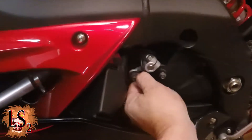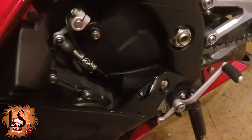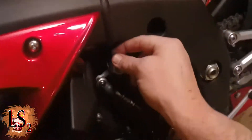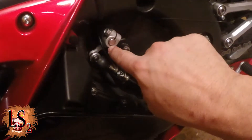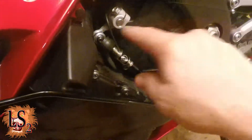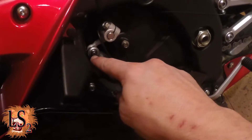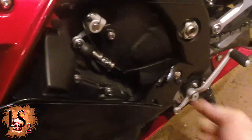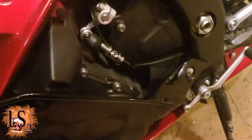The shifting parts are not too difficult. One thing that'll help you to get started is to disconnect — when I'm doing an oil change or whatever with the R6, I take the shifter rod loose here and just make sure I match up this flat line to a little dot there. But for this, it's much easier if you actually unscrew this little Allen bolt here and take it loose there, because then you can unscrew everything and just pull it out. I didn't even remove the fairing when I did this, and it really didn't get in my way.